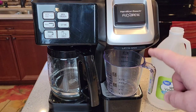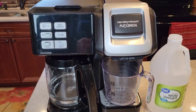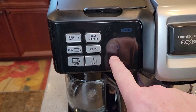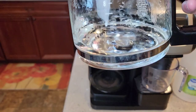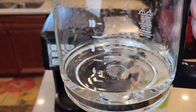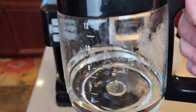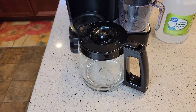Now we want to let this sit for 30 minutes on this side. But in the meantime, I can switch back over to the cafe side and finish up over here. This was that vinegar — I'm going to go throw it out and rinse this out with soap and water. You might see some white calcium kind of floating down — that means it's doing its job. If you see really big chunks, you may want to descale this a couple of times and increase your interval of when you're descaling.